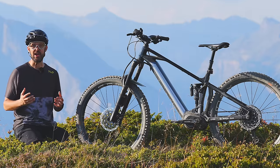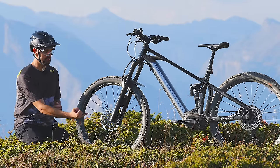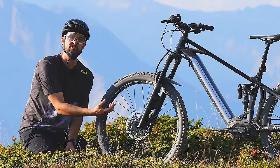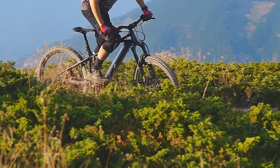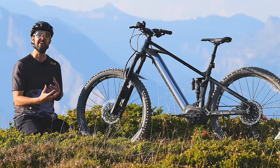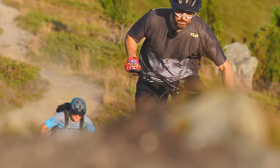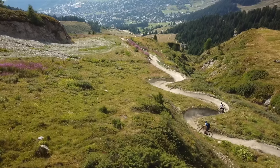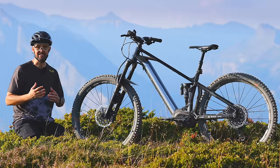The entire system is only 400 grams, which is pretty light for an ABS system on an electric mountain bike. That comprises the sensors and the hydraulic unit. The sensor ring uses a magnetic pickup, so mud, dust, or debris won't give false readings, and the pickup time is around three milliseconds — much quicker than a human can control their finger. The system has two configurations: a road setting and a trail setting. On the trails, you get a little bit more slip for more deceleration.